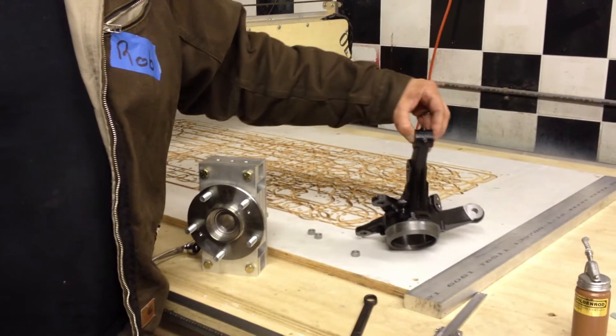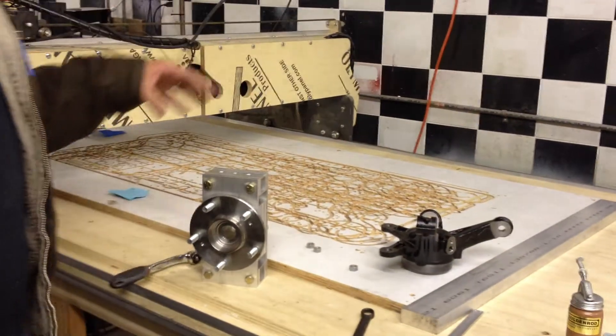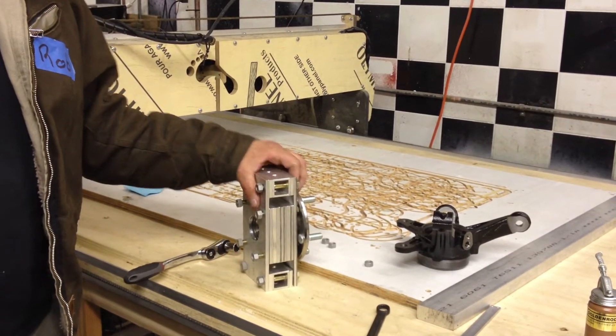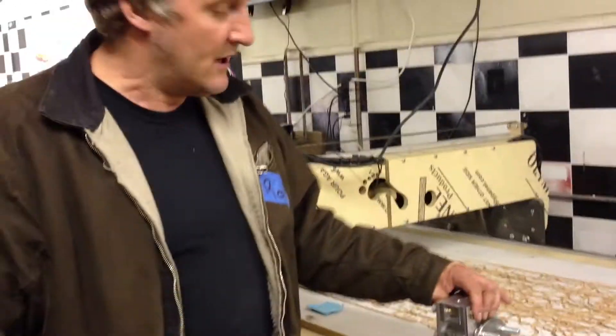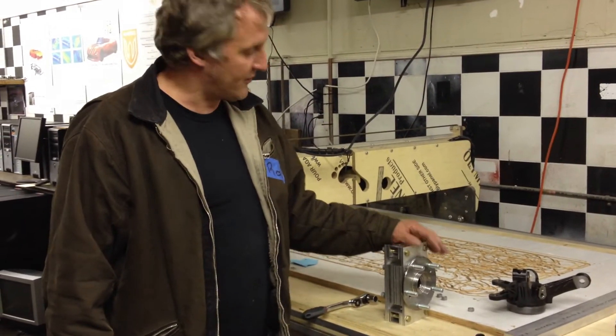It's also not modular — it really only fits the piece it was specially designed for. So we are building our own modular suspension upright. You can see it's made entirely out of quarter-inch aluminum plate, making it both light and easy to make. Practically home-tool, home-building — a part that normally would be considered very sophisticated and out of the reach of most people.